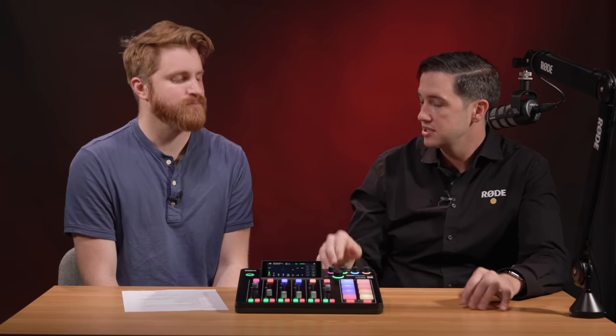For anyone in the gaming streaming space, you might want a dedicated computer for gaming performance and a separate computer to handle your live stream. With the RODECaster Pro 2, it has discrete audio interfaces, so you can literally connect two computers at once straight over USB and have the audio coming straight back into the unit and send your mix to both.